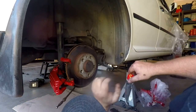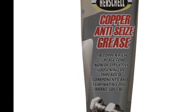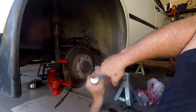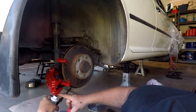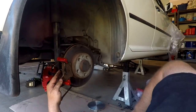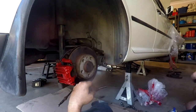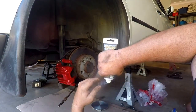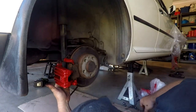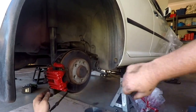Now that the masking tape has been removed, we can start with the reassembly. I like to use a little bit of copper grease just on the critical components of the brakes, particularly where the brake pad meets the mounting point of the caliper. Often this point can seize up and become a little dry, just causing squeaks, so a little bit of this is good practice. We're sliding the brake pads themselves back in here, making sure to get no copper grease on the actual brake pad or the rotor. I also like to put a little bit of copper grease on the slide pins for the caliper, just to make sure they slide along nicely. Also be sure that the dust boots fit back onto the correct location — this will keep out any dirt or water and ensure that the caliper can continue to slide as intended.